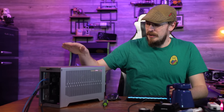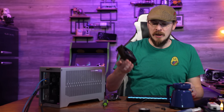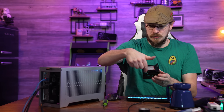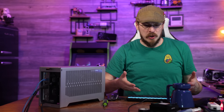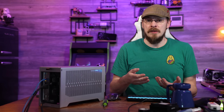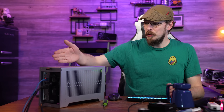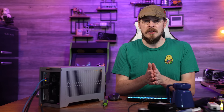Welcome back. I did a couple of things inside of this box. Number one, I swapped out from the BK034 to the ID Cooling IS40X. This cooler does have a pair of heat pipes that snake in an S-shape through the cooler. It does have a copper cold plate with direct contact heat pipes. I also added a small shim between the cold plate and the CPU itself, since there's a heat spreader on top of the mobile CPU die that is soldered to the motherboard — a much different configuration than a standard CPU socket.